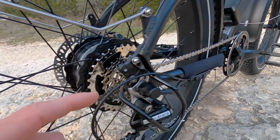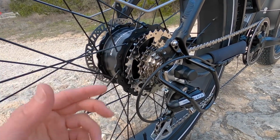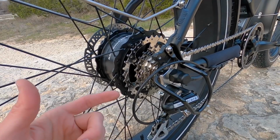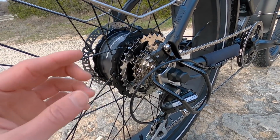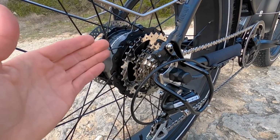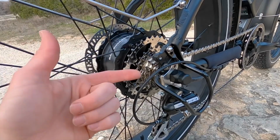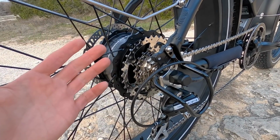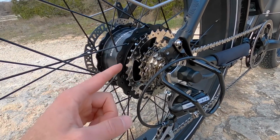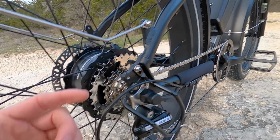You'll notice how shiny the chain is, and this freewheel. This is 11 to 34 tooth DNP nickel plated. So the nickel plating isn't going to rust. It's also more slippery. It's a little bit harder, so the chain's going to shift more smoothly. And having this wide of a spread compared to 14 to 28 tooth, which is a lot of other freewheels, so having that really big low gear helps you get started and climb, which is really important.